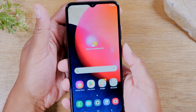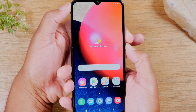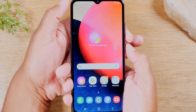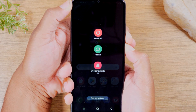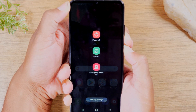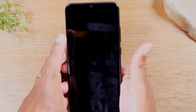Let me show you how it works. Hold down the power and the volume down button at the same time and just keep holding it until the screen goes completely black. After a few seconds the power menu will come up — continue to hold the volume down and power until the screen goes off, then let go, and that's it.